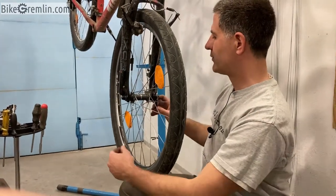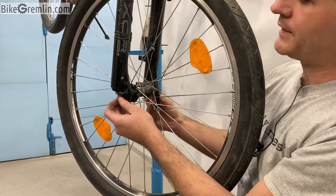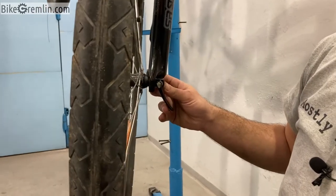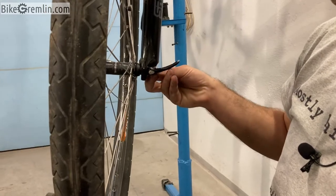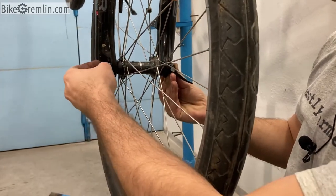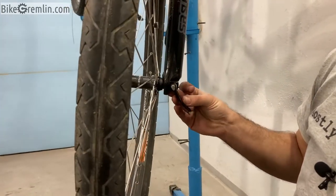It's simplest to do when the bicycle is on its wheels, but here I will improvise using my knee to keep it pressed upwards. The first thing to do is tighten this side. I'm basically tightening it until I can feel the lever creating pressure when it's pointing upward. It's got no pressure at all right now — I want to feel pressure when it's like this, so I'm holding it and tightening. Okay, now I feel it getting some pressure. I'll release this and test.